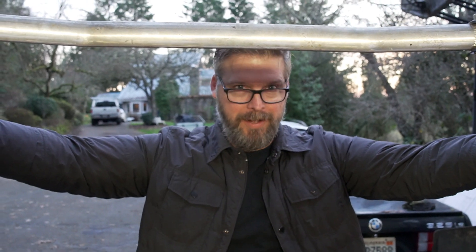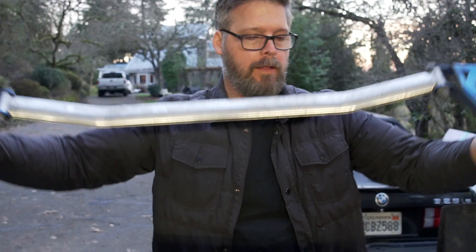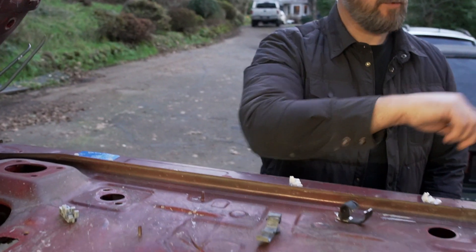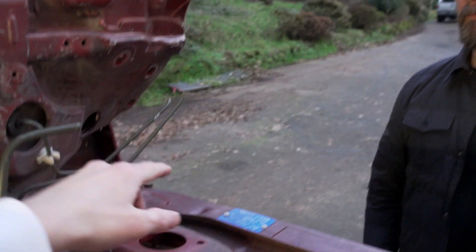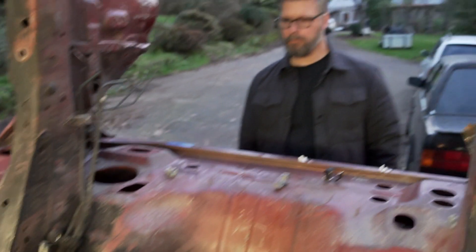The purpose is to make a jig, so it would make sure that when we put it back, first of all it stays all together, but also we can check to see how different or how much the same they are. This fits really nicely across this one, but it's not going to fit — it's a half an inch off on the other. I never would have thought of that. Seth kind of knows his stuff. He's done some frame repair before, so he's pretty knowledgeable on that. The idea is that you have measurements to all these little points that really increase your confidence. You stick all the bolts through so that hopefully when you reattach this whole front end onto the new car, it's aligned as best as it can be — probably hold it there while you weld it, keep it from moving while it gets heated. It's going to take a bit to make that, but it'll be a crazy looking piece. Skyline jig.